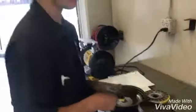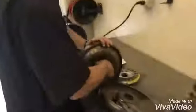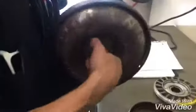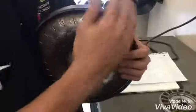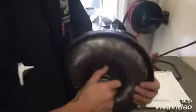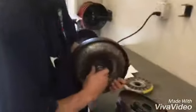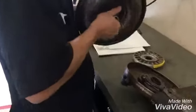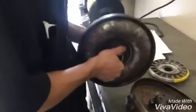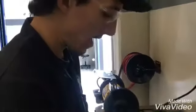The third phase is the coupling phase, where the turbine starts spinning fast enough that it almost matches the impeller speed. The turbine isn't ever going to reach the exact speed — there's about a 10% power loss — so you're really only going to get the turbine up to about 90% of the impeller speed. Once that happens everything starts spinning at nearly the same speed, but there's still a power loss because the fluid has drag.